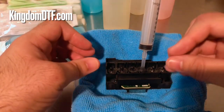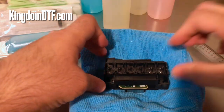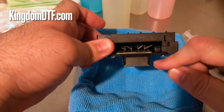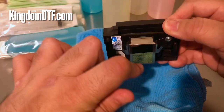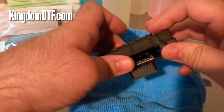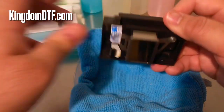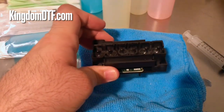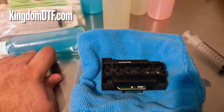One very important thing: do not wet your electronics. If you're putting the printhead in a bowl of liquid, only submerge up to the point where the printhead gets liquid, not the electronics. If you're not sure whether the electronics will get wet, put some tape over that area to protect it — only the printhead nozzle area should contact the liquid. Some people leave it soaking for 12 to 24 hours depending on how bad the clog is.